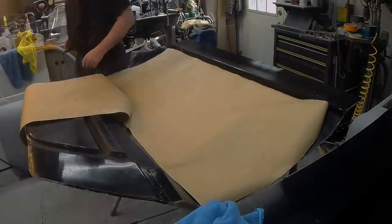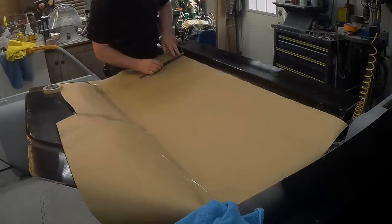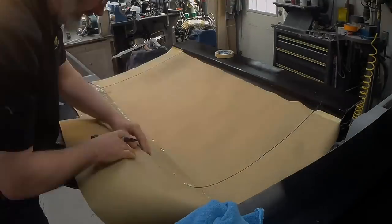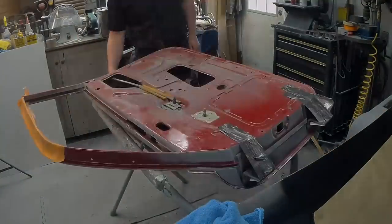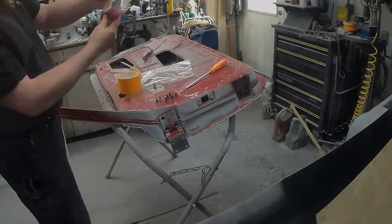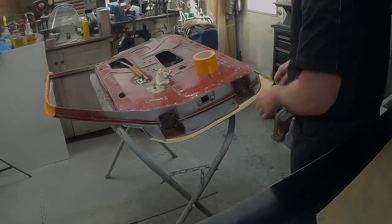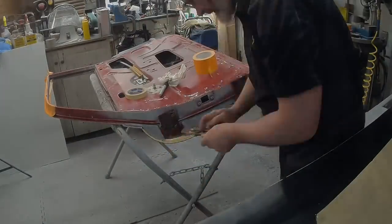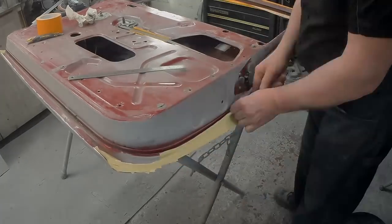One of the fun parts of doing this is making a lot of patterns. The first part I'm making is a pattern for the core, using brown paper cut to the inside of the mold. Then up comes the door and I pull the hinges off — they're quite stiff so I'm mixing a little acetone and ATF, which is the best cheap penetrant you can make. Now I'm making an edge pattern for the foam core; the back of this door is a complicated shape so I'm using masking tape to pull the shape out, cutting neatly around it.